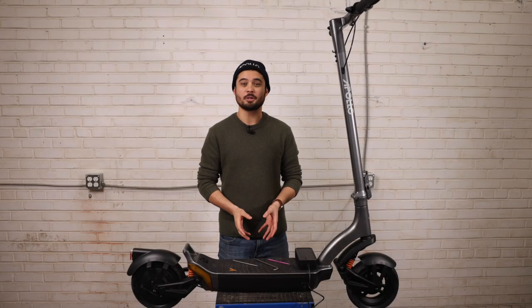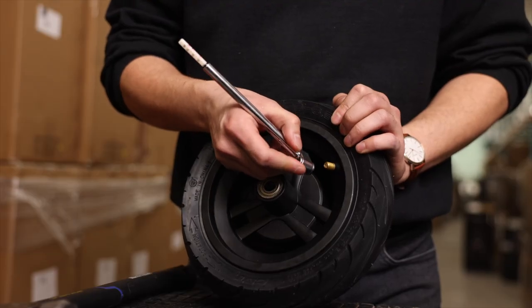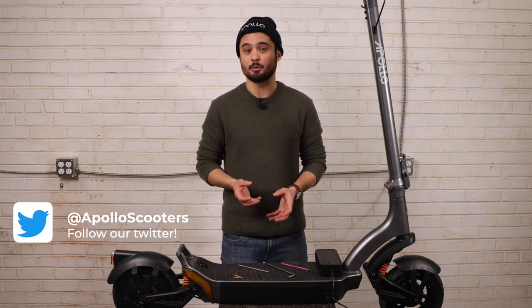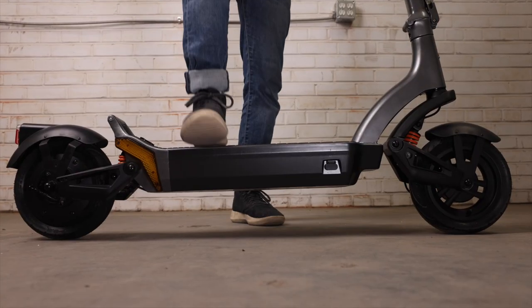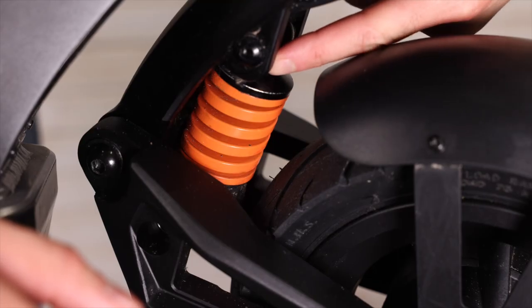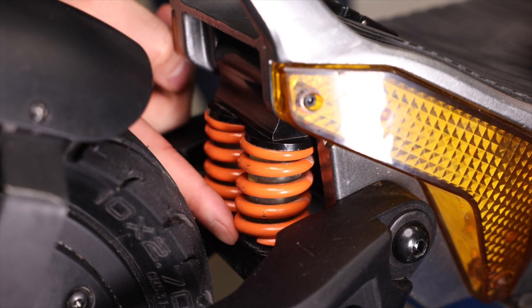While we wait for the scooter to be fully charged, we can also perform a quick maintenance check and cover some basic maintenance tips. Starting with the tires, give them a good squeeze to ensure they're inflated properly. If you have an air pressure gauge or an air pump with a pressure indicator, even better. Your tires should already be inflated to the ideal tire pressure of 45 PSI. However, sometimes some air pressure can get lost during the shipping process, so it's always a good idea to double check. Be sure to periodically check your tire pressure every week or so once you start riding. Next is the suspension — you can place the scooter on the ground and stand on the deck to see if the suspension squeaks at all, lightly jumping up and down. The suspension should be lubricated already, but if necessary you can lubricate it by spraying lubrication at the pivot points. If you ever need to lubricate the suspension after you've put some mileage on your scooter, it's important to clean the springs first to ensure you're not mixing lubricant with debris. We recommend spraying it down with WD-40 first. When it comes time to maintain your brakes, we've already covered how to adjust them and that's pretty much all there is to it.